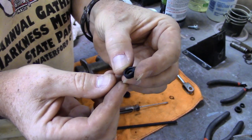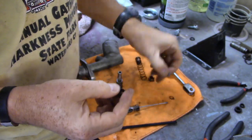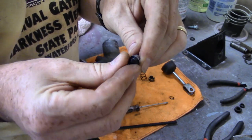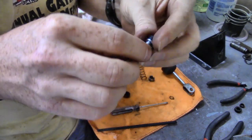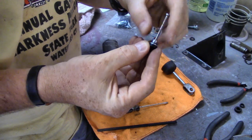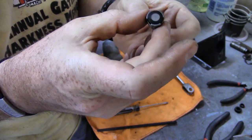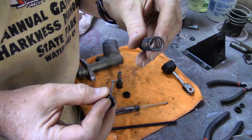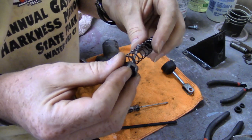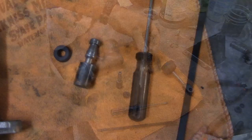Got the rubber seal off. This is the little rubber seal that goes on the plunger end - you can see it's kind of drilled out a little bit on one side, and that side's smooth. You've got this with a little notch cut into it, so you want to put the bore end down onto there and it just kind of presses on. Then don't forget your little spring washer that goes on next - that all goes into this little cup, fits down like that, kind of bounces back. Then stick it down with the spring lined up - the end of the pin goes into the larger end and down to the smaller end to stay in there.